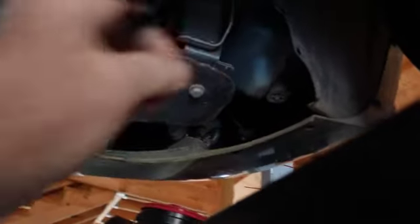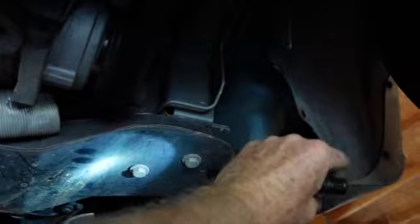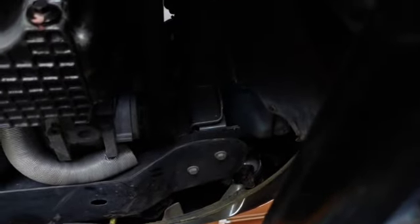There's a piece missing there - that's wind noise right there. This is the noise I'm talking about - see, there's the piece missing. This is what we've got to flatten up. Wait a minute - I think I see the problem. That goes right here. Wait - listen to me now. You're going to have to get this piece because you're slinging water right onto your belt. That piece missing is no good. We need to go to the Chrysler dealer or make something to put there, because you're throwing water all over your belts.